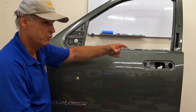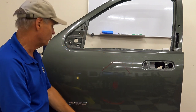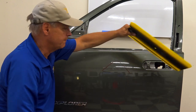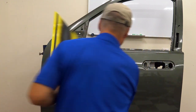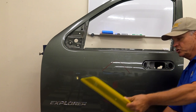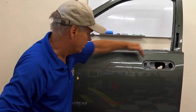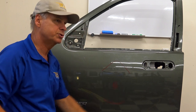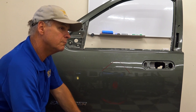Nope. Next thing we're gonna look for, and you saw them in that black car you just did. That's the one. Well, you see 45 degree pressure caps right there staring in your face. So what we do now is we take our same board with our pinstripe, we run it at a 45 degree angle here, here, and there, all four directions. All four directions through the dent. Start about 6 inches away from where the dent used to be. So if the dent was there, you start up here, go into the dent, here, all the way into what's left.